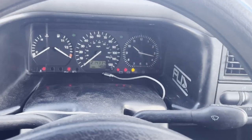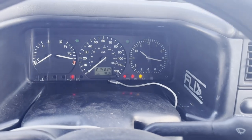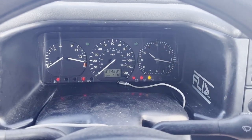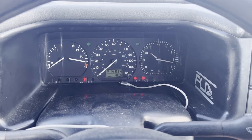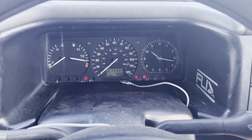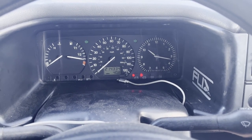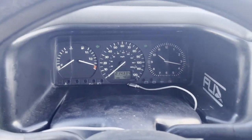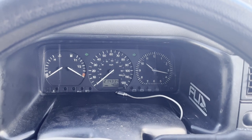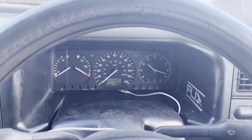I still have three out of five glow plugs but I've got the better battery. It is cold — about four or five degrees C. I'm going to give it a go with the plugs again. I honestly don't know if this is going to work — I might need a bit of the spray. Yeah, I'm going to give it a bit of the spray because it's still on three out of five plugs. I'll get the other two plugs replaced soon at the garage.